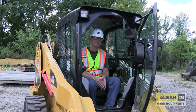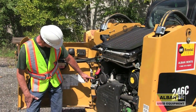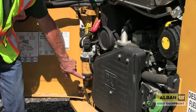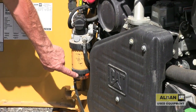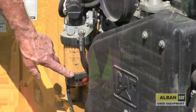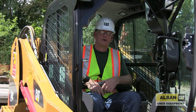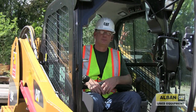You want to give that about two minutes. You want to ensure that this pump is running, and if this bowl is empty from running out of fuel prior, that the fuel has filled up in this clear bowl. After a two-minute period, you can go ahead and crank and start the engine, and it should prime.